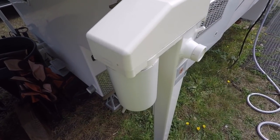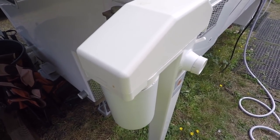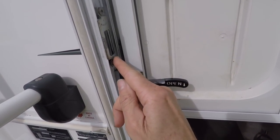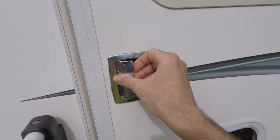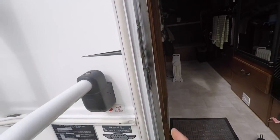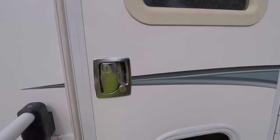I have the 4560 model. They do say that you should run the jacks periodically — like once every six months, run them all the way up and all the way down. But that is one issue I have had. One other thing — the rear door. I have had to do a little bit of modification to the rear door; at times it has been riding on the metal. When I close the door, I've had to grind a little bit of metal to get the door to fit and close properly. A lot of that has to do with how level the camper is in the rear.